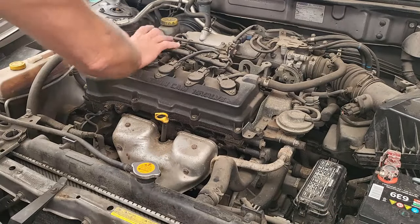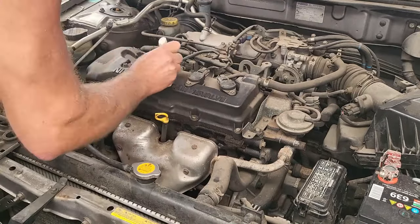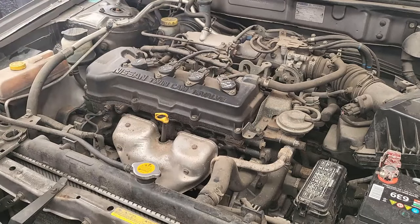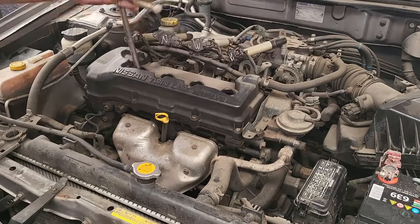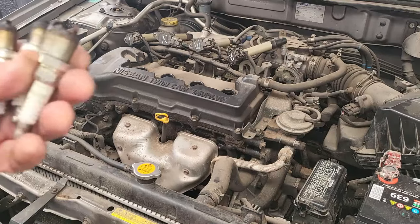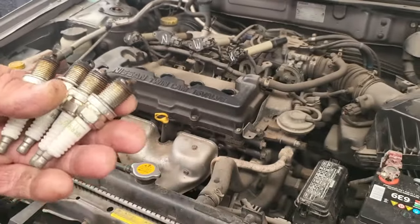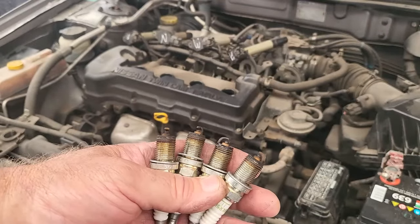Right, so the first thing I will do is take off the coils and mark these coils, basically get them loosened up. That's just a size 10 bolt that will be holding them. I've been in here for a while, it's tight. Okay, if you look at that, the plug is wet, it's full of petrol. So I would suspect number 3 cylinder is misfiring. It could be anything.